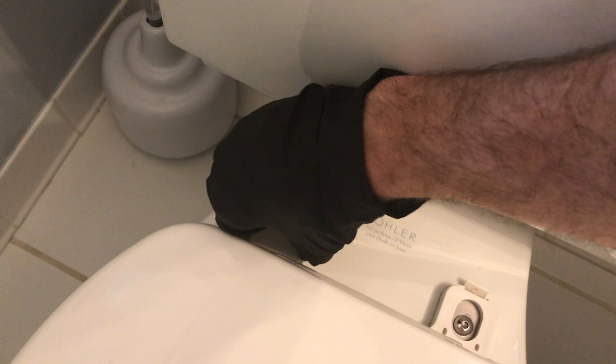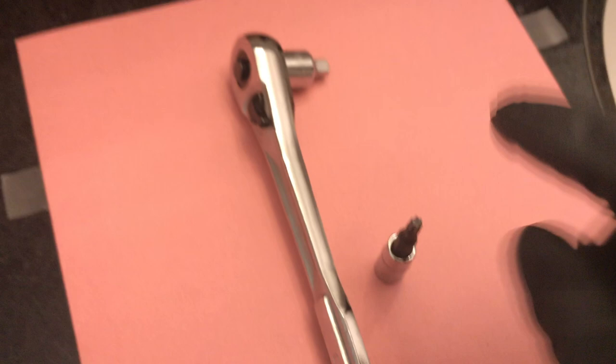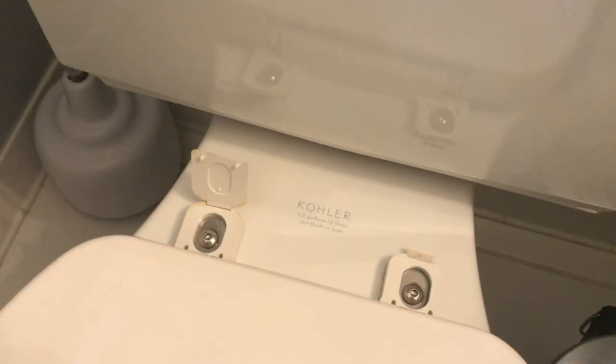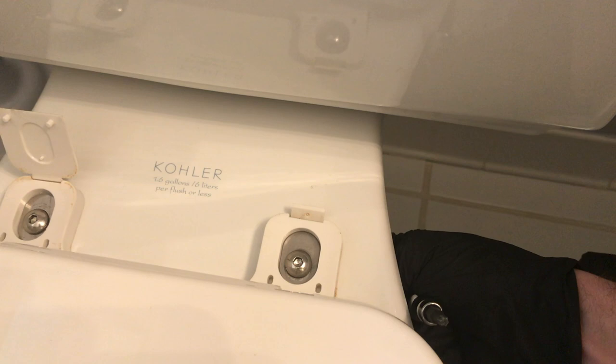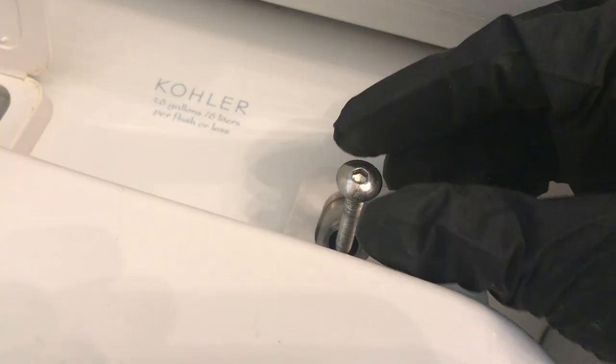As you can see it's a flap, and inside here is a T-bit. We want to grab our T-25, insert it onto the ratchet, and we are going to loosen up that T-screw. I'll start with the right side. As you loosen this T-screw up it will get to a point where the ratchet isn't really working unless you put your hands underneath and grab a hold of the additional connection point, add a little bit of tension, and continue backing these T-screws out.